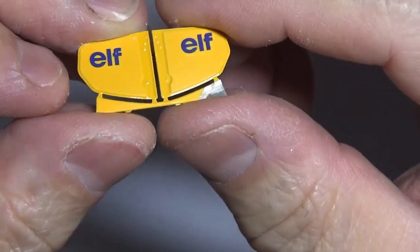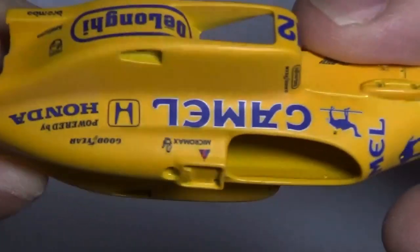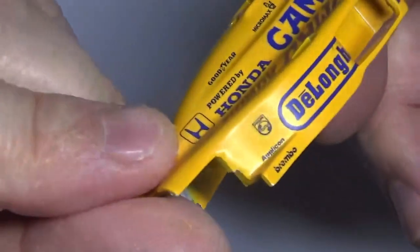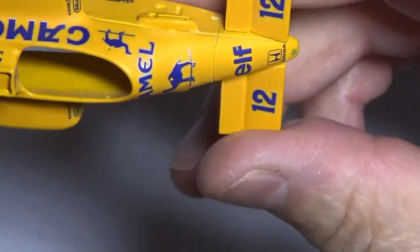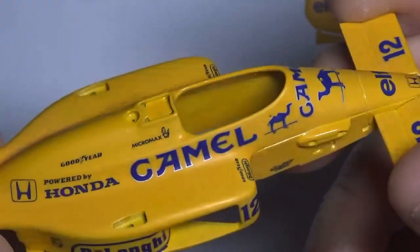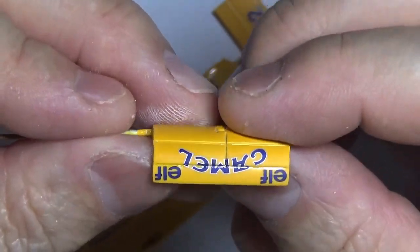When you don't see any shininess around the edges of the decals, you know you have a very smooth surface. And I'll wash all the parts and have them ready for the final coat of clear coat. One thing I forgot to mention is you must make sure the clear coat is completely dry before sanding. I usually wait for a week at least.